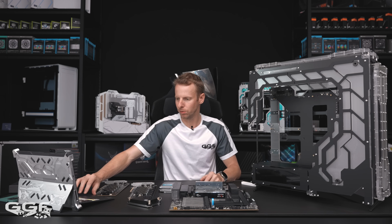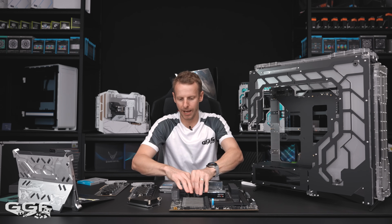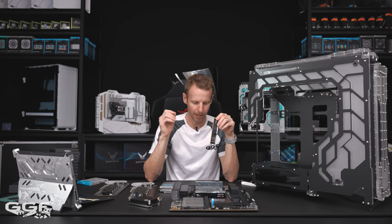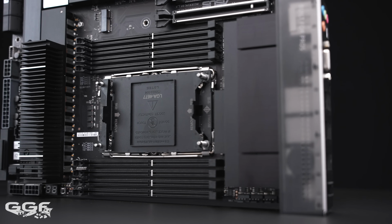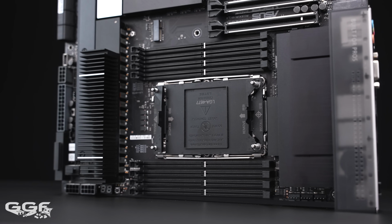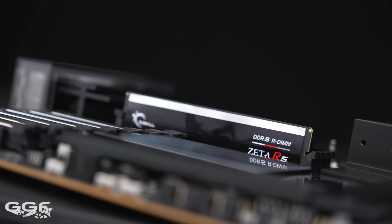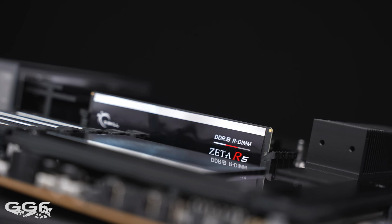Moving on to the memory. G.Skill sponsored, I might pop out a bit of this, 8 DIMMs. Of course I wanted 8 because this board can utilize 8 channel. That's another thing with the 34 series. With the 24, it can only do 4 channel. This one can do 8. So I'm not sure if it can make any difference, but I just wanted to pick that up anyway. May as well utilize everything the board can do. So shout out to G.Skill for sponsoring this. This is 128 gigs. This is 6,000 megahertz at CL30. So that's pretty tight timings right there.